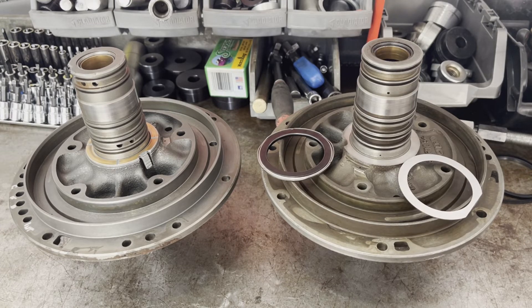If you don't do this and try to just drop the bearing in, in the overwhelming majority of cases it's not going to fit. You're going to have either a bind-up or insufficient end play. End play in the front of these transmissions needs to be between 10 and 44 thousandths. I personally like to run my end plays between 10 and 20 thousandths — that's the target zone, especially for high performance. If you're less than 10 thousandths, you're going to have bind-ups inside the case during vehicle operation.